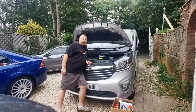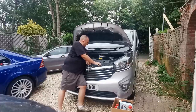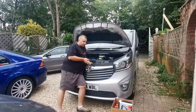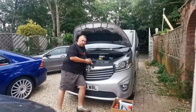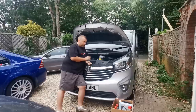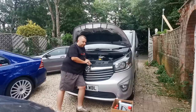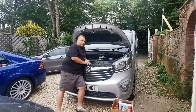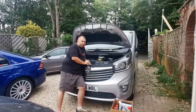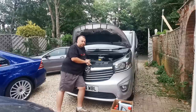Welcome back everybody to a long-awaited video on this Vauxhall Vivaro - a 2014 1.6 turbo model, long wheelbase. Today we're doing a part service: the oil filter, air filter, cabin filter and oil. They didn't have the diesel filter in stock so we won't be doing that today. It's quite a bit of oil - 7.4 or 7.6 litres - coming in at about 76 pounds. There was another option for 68 but for the sake of eight quid difference between trade oil and the recommended for this engine, I went for the recommended.